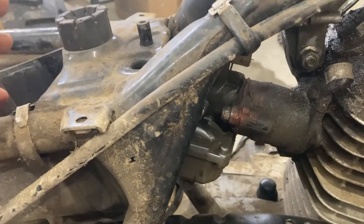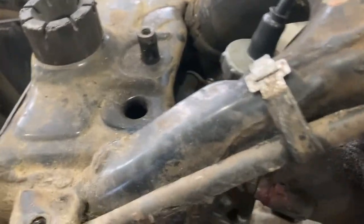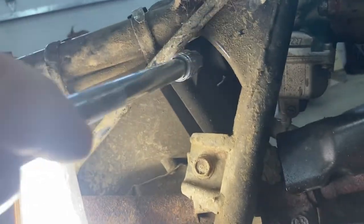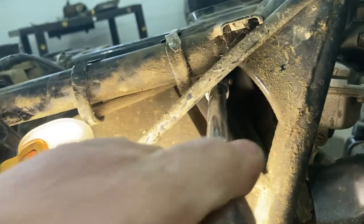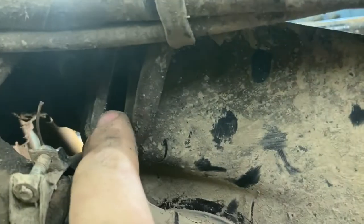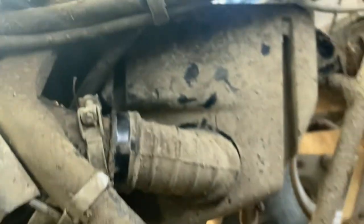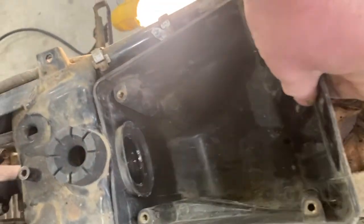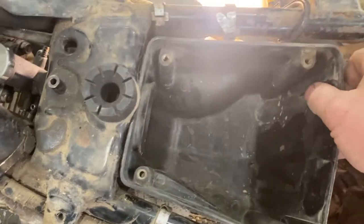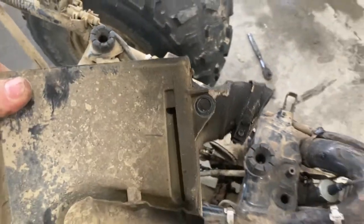You can watch other videos on how to install the carburetor — it's just the opposite of doing it this way. Getting at the two clamps at the carburetor end, taking those off, broke it loose, and now back on the other side by the boot. Looking up under here it's hard to see, but putting the 10 millimeter socket on and breaking that one loose. Now getting it by hand and maneuvering the air box out of here. Air box is out.